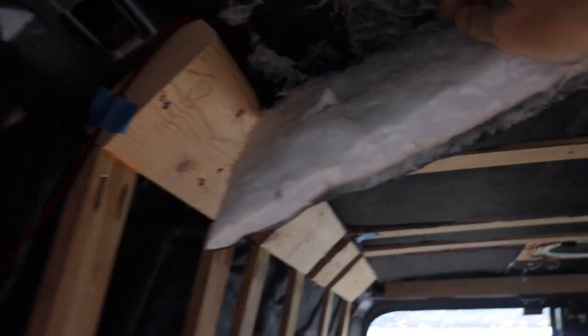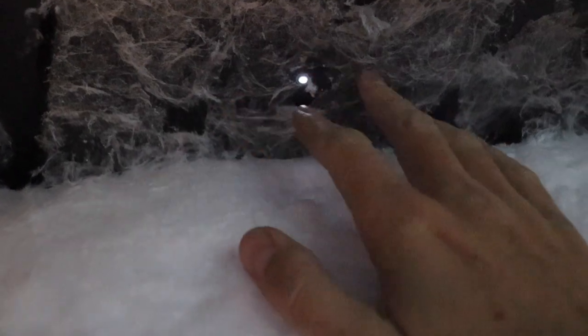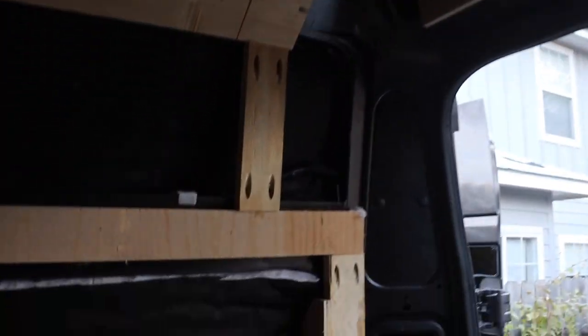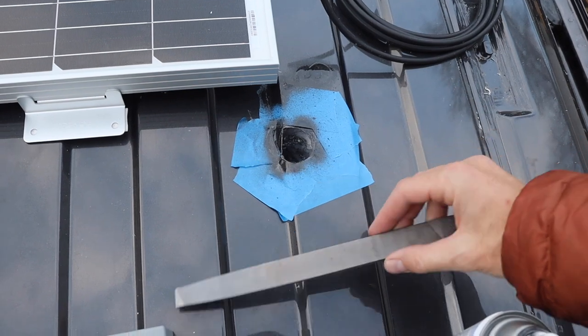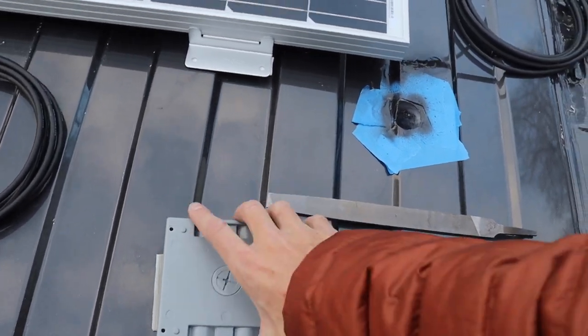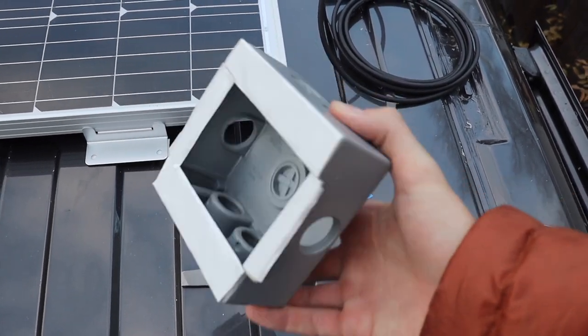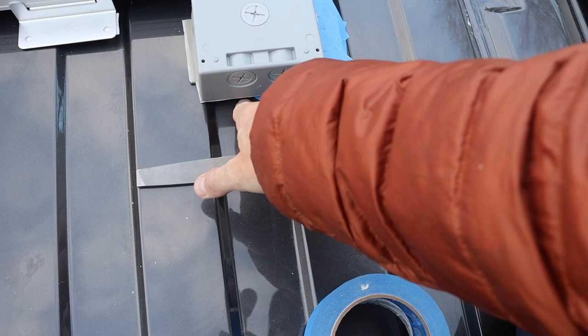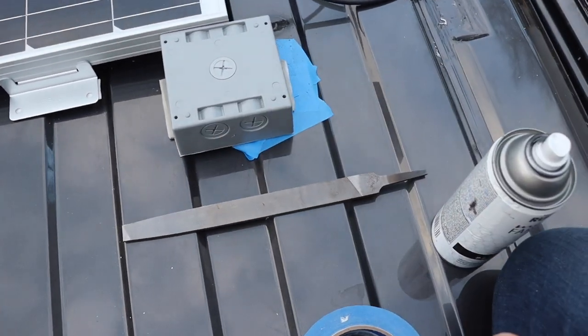Coming to the inside of the van — here's the slider door, and right up here is where I drilled the pilot hole to see where it would go. I had to peel some insulation back. It probably would have been a better idea to do this step before insulating, but it's really not that big a deal. I like the spot and the position. I'm going to drill my inch-and-a-half hole here and run the cables so they stay behind the tongue-and-groove ceiling I'm putting in. I noticed there's still a bit of a gap underneath where the valley is, so I'll double up the butyl tape there, just like I did on the Maxxair fan.